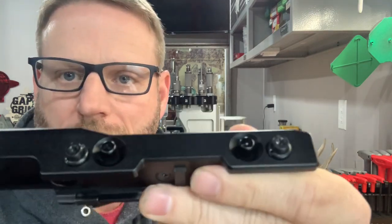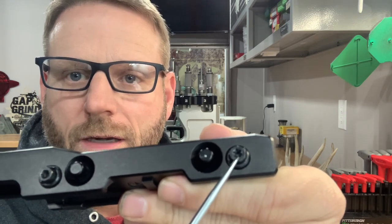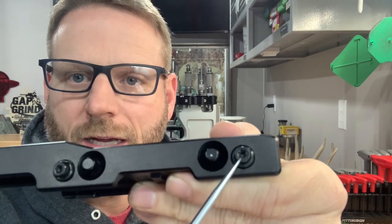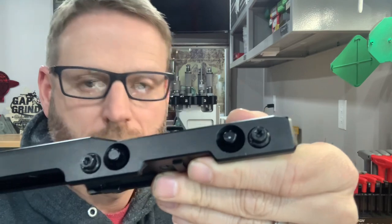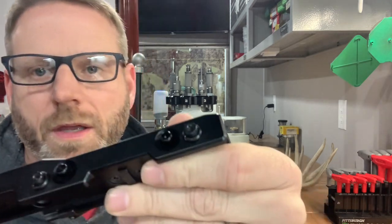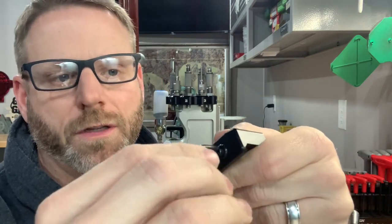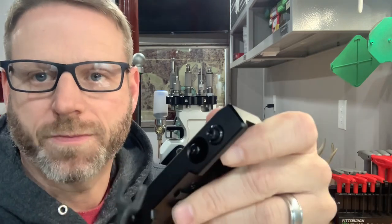On this, you've got an outside nut and an inside nut. The outside one is just a lock nut and it's backwards thread. What you'll want to do is take the provided tool, that's Torx on one side and a spanner wrench on the other. Take the provided tool and loosen this lock nut to the right. So turn this to the right and relieve the pressure. And then take your spanner wrench,